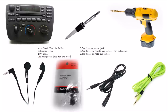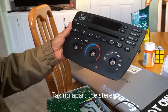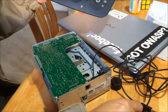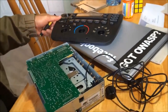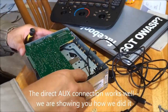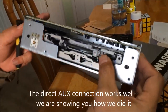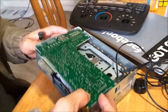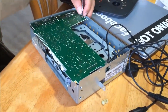For this video you will need the items on screen. This is a Ford Taurus and I am installing an AUX input. I've already made the connection — I'm just disassembling. This is the CD unit; I've isolated it, there's still a CD in it, and I'm removing the radio module.